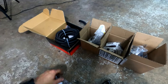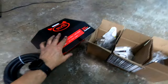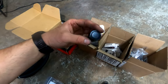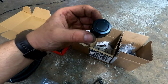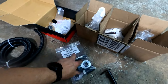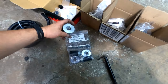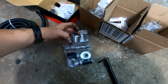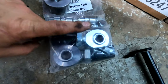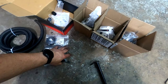Here are some of our parts: we have Evil Energy black nylon braided hose, 10AN — I've had good luck with that on fuel stuff. We've got 10AN caps here because sometimes you need to cap off stuff when working on the fuel system so you don't have to drain the tank. Here is our Bulk Metal Craft active toe eliminator kit; I do have a kit on there now from 1999, so I'll redo that welded correctly, and we'll have additional toe adjustment just in case we can't get it perfectly aligned.